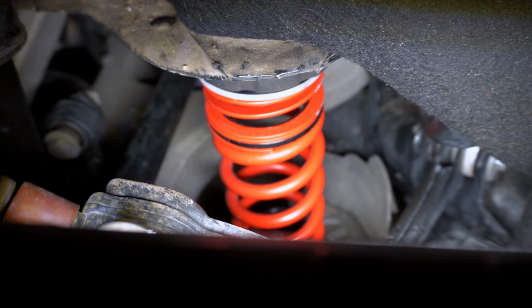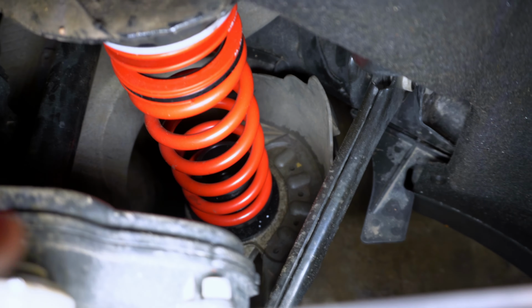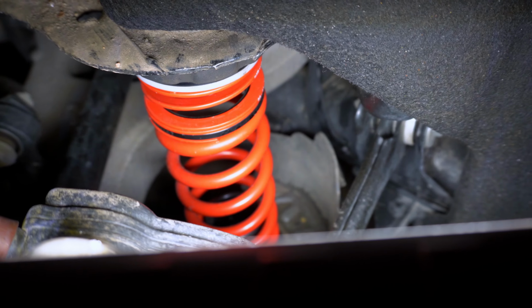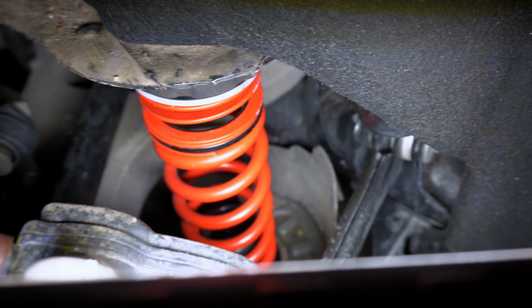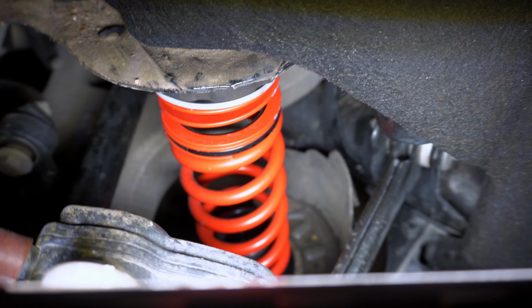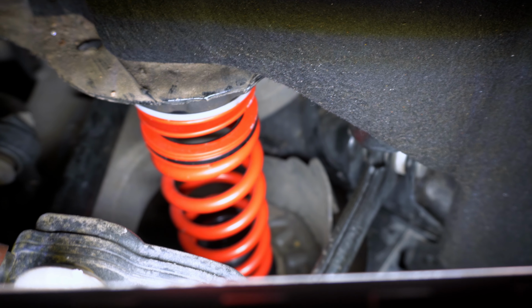Now we don't need a spring compressor at all. You can fit a regular standard spring compressor on one side, fit one right here on the other side between that arm. Just use a spring compressor, compress the spring, it'll slip right out even with the compressors on it. There is more than enough clearance. You don't have to step on the hub at all. You don't have to stress the components. It will come right out, no problem at all.